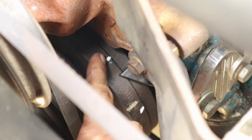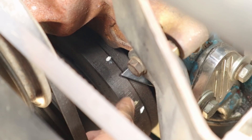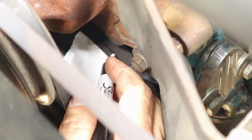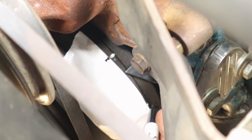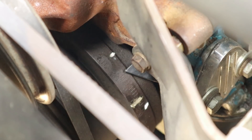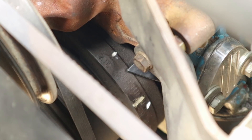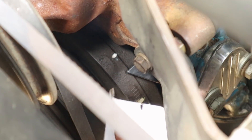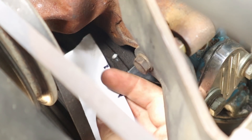To find your exact top dead center, you want to measure and find the exact middle between these two marks — which is interesting because on my harmonic balancer this is zero right now. So I put a piece of duct tape on the pulley, marked my two spots, pulled the tape off, and measured the distance between the two marks. I used the tape because it's super hard to get a measuring tape in here, so transferring the marks to duct tape lets me lay it on the workbench and measure it.